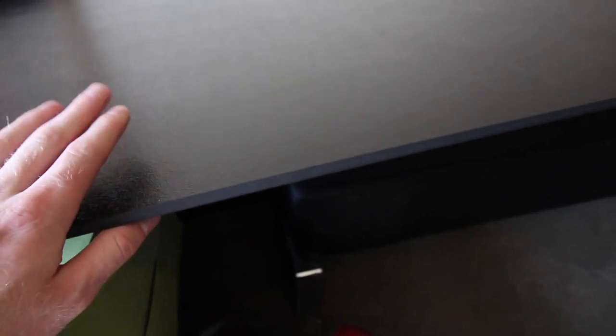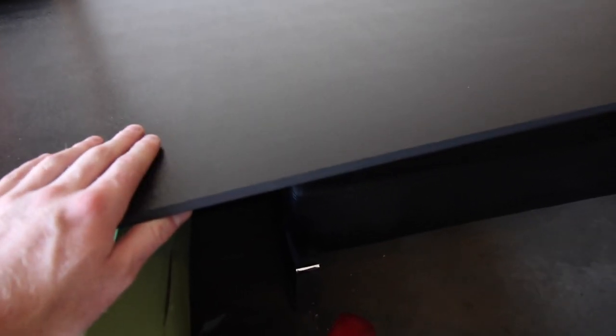If you haven't checked out the first video, definitely go watch that. I go over how I created the template. I ended up going with 3/8 plastic, and I chose a bit of a thicker plastic as I wanted something that was gonna be a lot stronger, a lot more functional. A lot of splitters out there are pretty thin, and with that, they'll flex a ton, and often they're screwed into the bumper, but this one I wanna actually mount to the frame of the car, so I really wanna have a functional chassis mounted splitter.